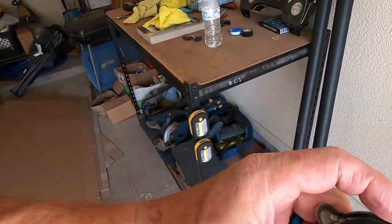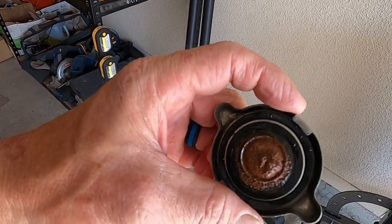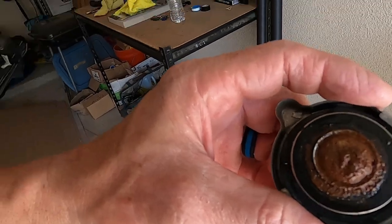I'm gonna show you what I got. I pulled my radiator cap off and look at that brown stuff on there — that doesn't look very nice. I figure that's probably running through the engine and through the radiator, so I'm gonna break the water hose out, pull some hoses off, run some water through it, and flush it out real well.